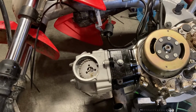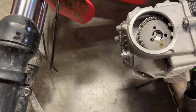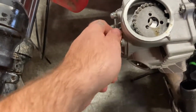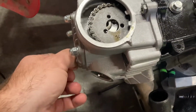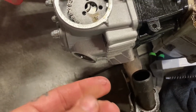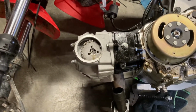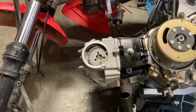Again, that's one thing I noticed up here on the studs. I may get online and see if I can get the studs for it as well. I think I can thread them out maybe, but they did tighten up. I've just got one here on the bottom that I actually stripped the castle nut out on when I started tightening it. So I probably need to get the longer studs to do it right, and go ahead and get the timing chain as well.